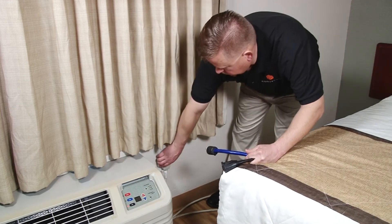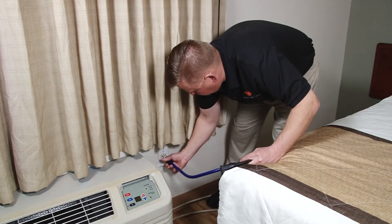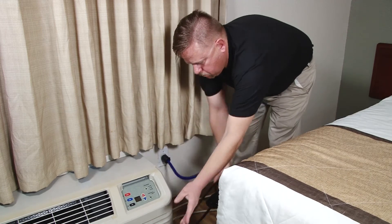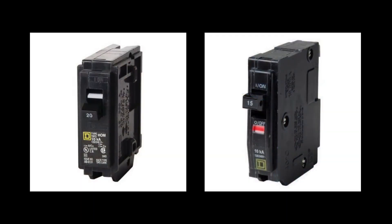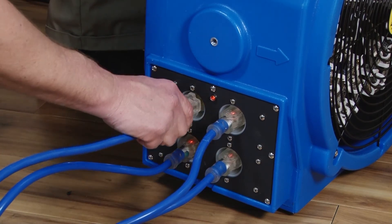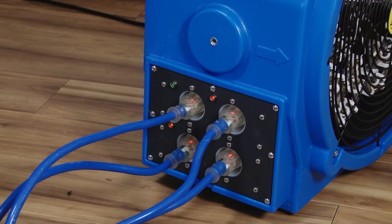To power the Elite 4 heater, unplug the PTAC and plug in the 2-way power adapter splitter. The adapter provides you with two power cords. Plug those two power cords into two of the receptacles on the side of the heater. Next, find two 20-amp or 15-amp 120-volt circuits. Use these outlets to run power cords to the remaining two receptacles on the side of the heater. You now have full power going to your heater.